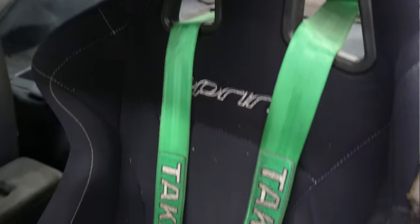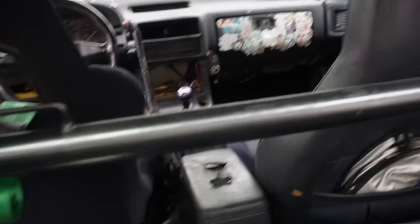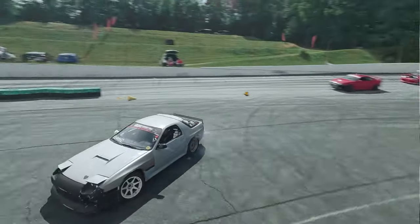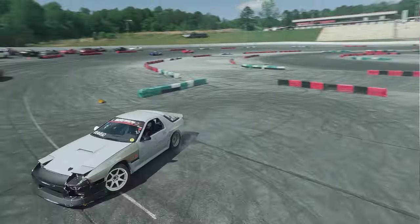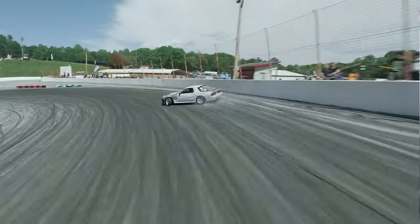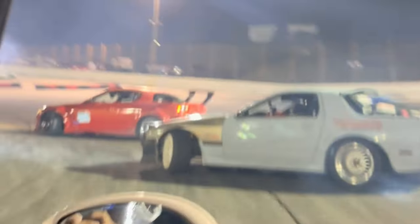I would suggest getting a bucket seat and a racing harness — make sure to get the harness bar too. If you're just starting out doing 180s or donuts or figure eights, you probably don't need the bucket seat yet. But when you get more comfortable and want more speed, your body is gonna sway everywhere from the g-forces. With a bucket seat and racing harness you'll be planted in one place, feel the car much better, and be able to drift with greater precision. If you're starting out, it's okay to keep the stock seats for now — but definitely get the bucket seat later on.